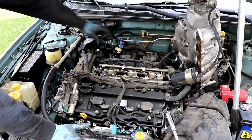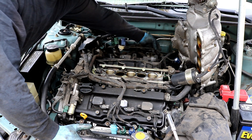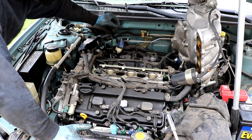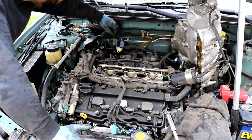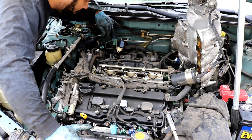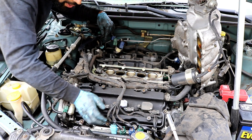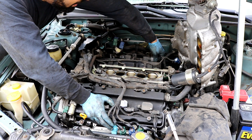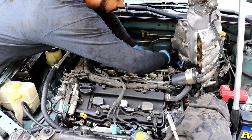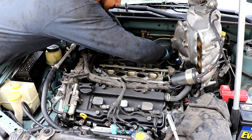This is the bracket I was talking about on the back that was still attached to the manifold. Now we'll move whatever wiring harnesses are in the way. Go ahead and disconnect all the coil pack connectors — they're just tabs you press. Keep in mind they're probably old, so try to be as gentle as you can so they don't break.